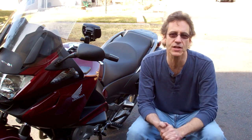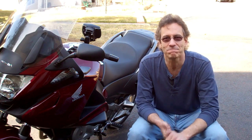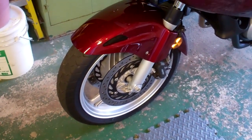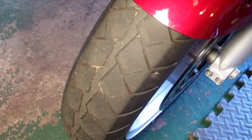If you're interested, we're going to walk you through it step-by-step — you might want to watch just to get a few little tips and tricks. We're going to get ready to have some fun and take the front wheel off the Honda NT700V. The reason we're taking the front wheel off is we've just hit 13,000 original miles, and the front tire is starting to look a little dragged down. You can see it's got some cupping wear, it's getting pretty thin, and it's about time the thing gets retired.